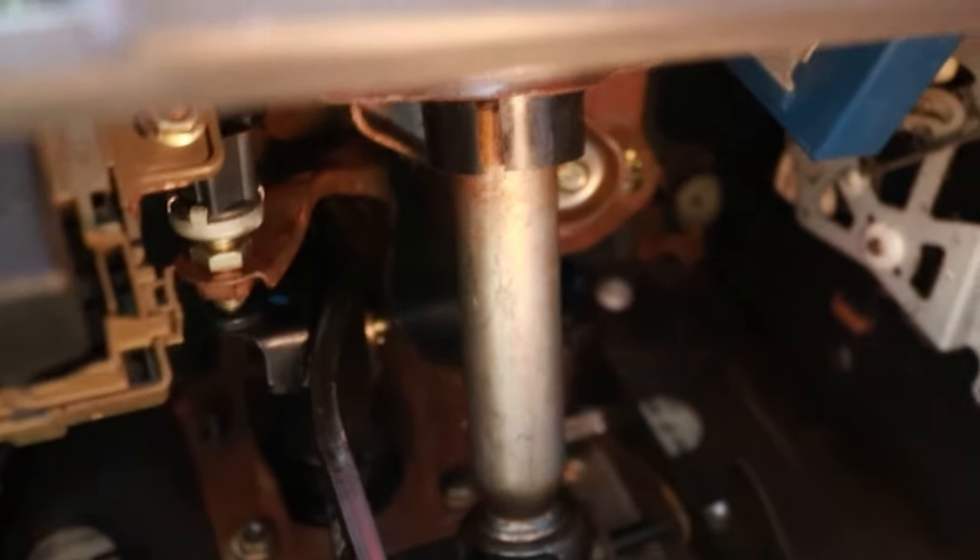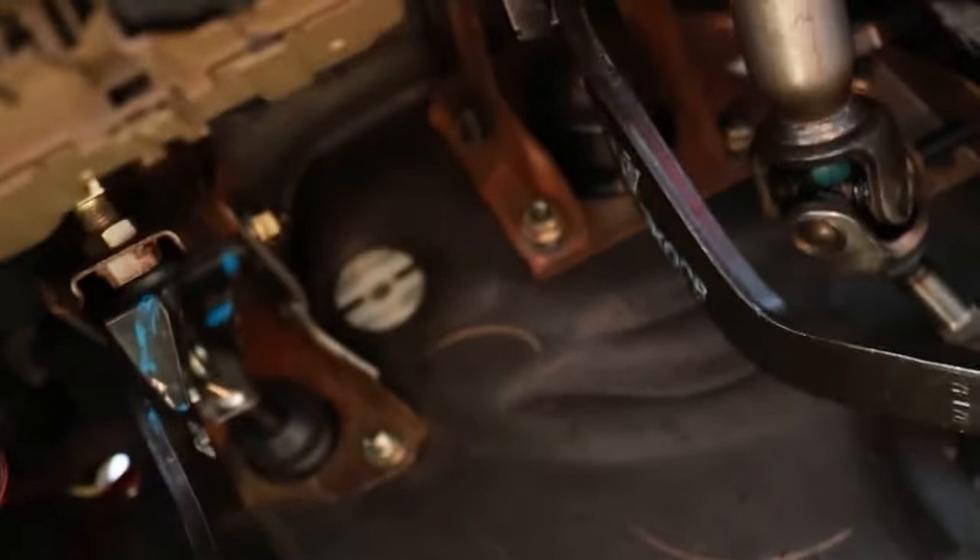Here's a quick tip: people usually pull out the whole assembly, but you really only have to pull out the pivot pin and unlatch that spring. That's all it is if you don't want to take out the whole assembly. I'm not sure if you have to drop the column or not — I didn't have to do it this way. Don't forget to adjust any links and make sure your brake lights aren't going off all the time. Also look up how to adjust your clutch link as well.